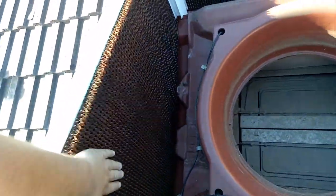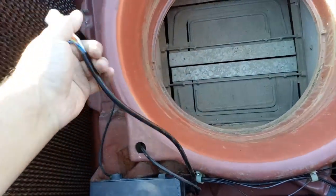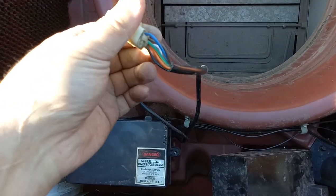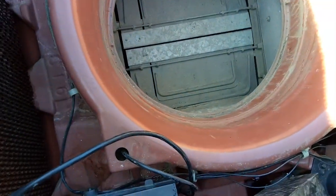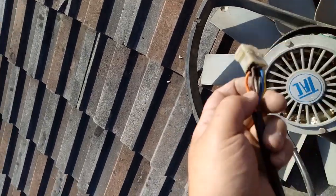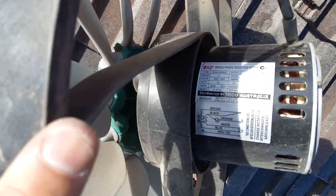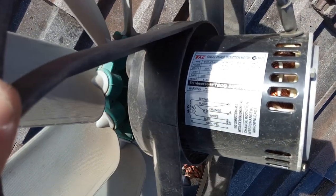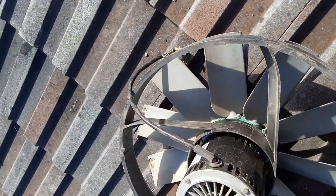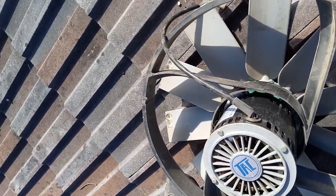The whole thing is basically 88% humidity all the time whilst it's running. If we look in this plug, those pins are quite black. You've got white and blue connections — white goes through your capacitor and blue is your neutral. That is why it was not arcing all the time — it was only on high speed and very low speed. On low speed it needs the capacitor, and on high speed it needs the capacitor quite a lot as it's under load. Start-up current is high, so that's when it would also trip whilst starting up.